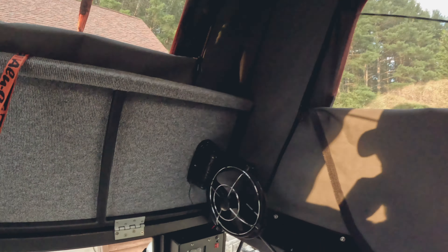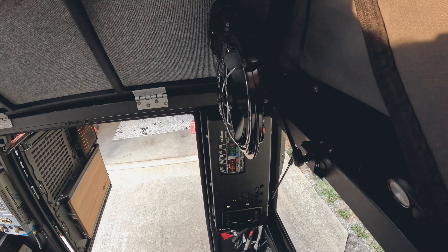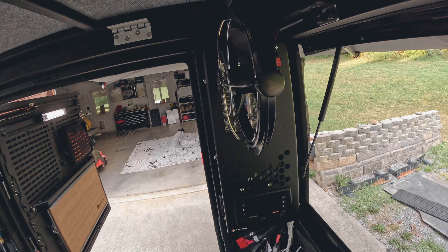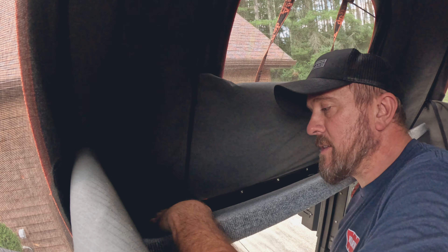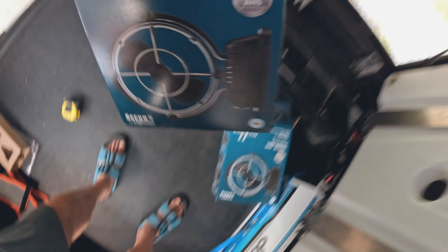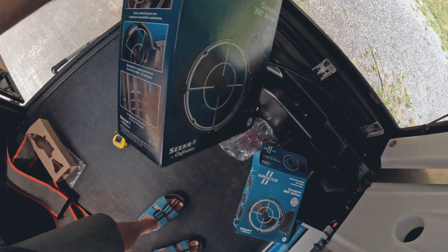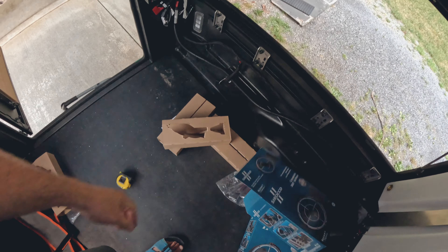I don't want that especially on these last few hot days. It'd be nice if the fan was almost blowing directly at your face or down on you. I'm not going to attempt to run wire through all this stuff, so I found a really good spot to mount this — it clears the strut perfectly with about a half to three-quarters of an inch. In transportation it'll just hang. The instructions call for mounting in six locations, which is way overkill based on how I used the fans last time. The fans are not the cheapest but they're extremely durable, pump out a lot of air, position just about anywhere, and have a three-year warranty.